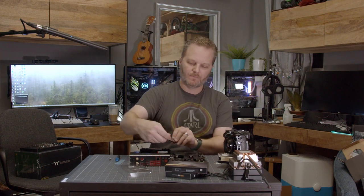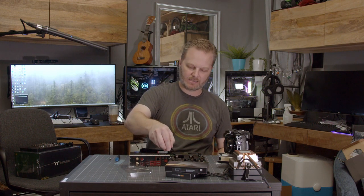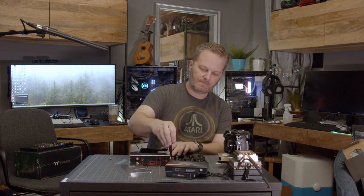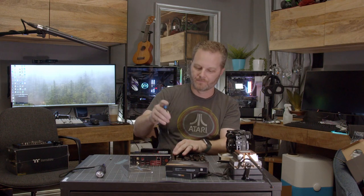Now retaining the M.2 drive properly. Take the heatsink — the sticky side faces the drive — and line it up from this edge in. Screw the other side of the heatsink down. Make sure it's in there nice and snug, but don't over-tighten it, and we're good.